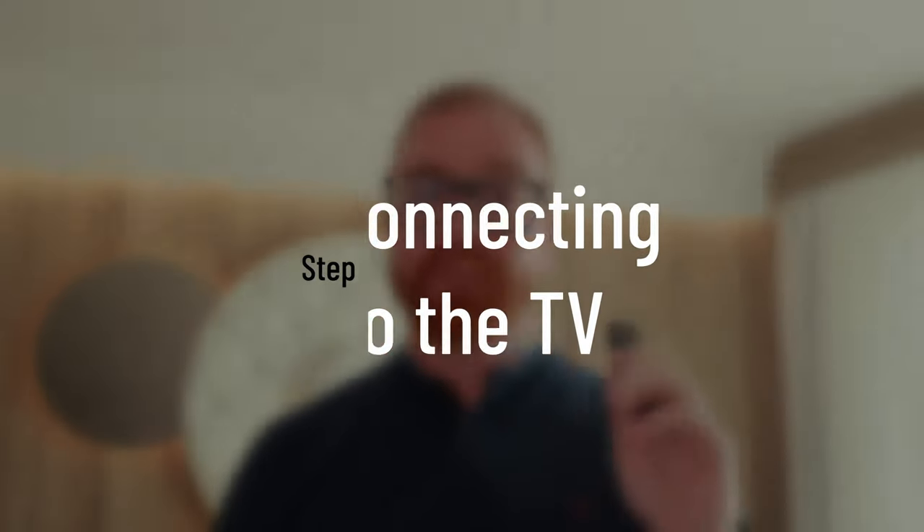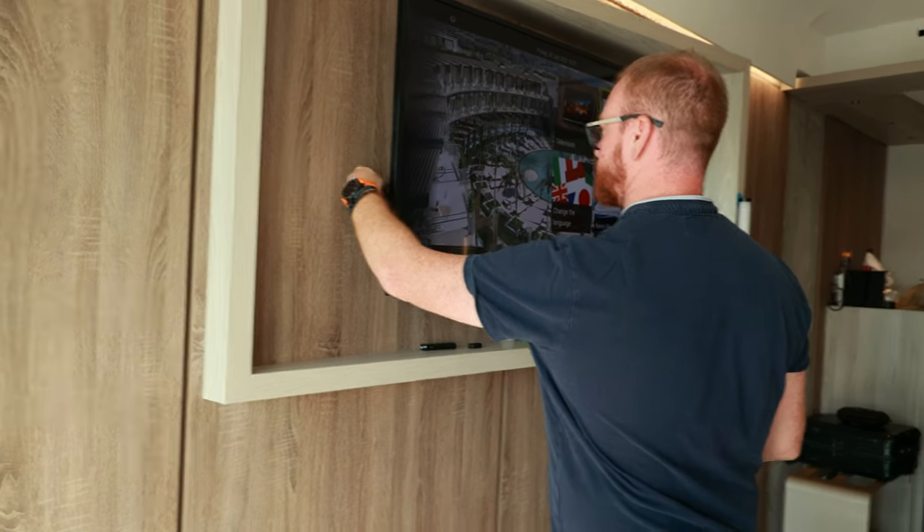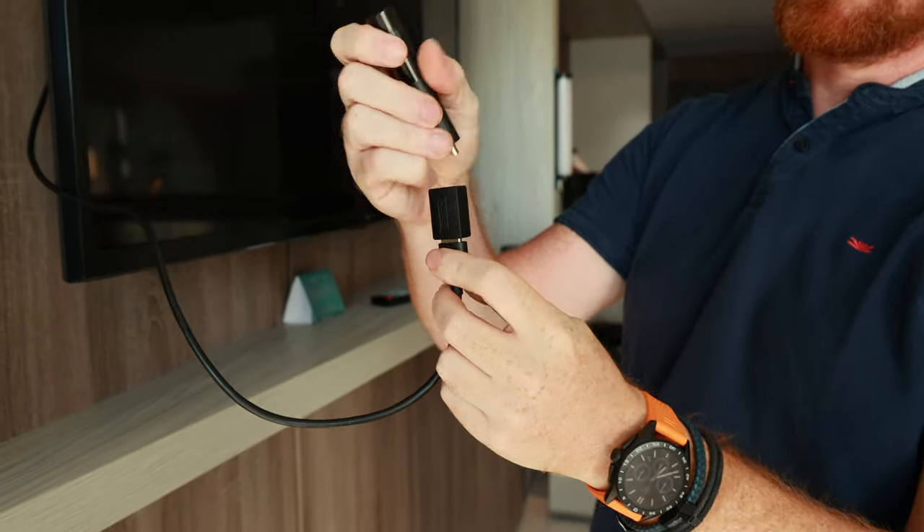Now that we have the hardware, step number two: connect the hardware to the TV. It sounds easy, but it's not as easy as it sounds. If you're really lucky, you have the HDMI and USB ports of the TV just exposed, and then you just plug the streamer in there and connect the USB power — that's it. In many hotels, you have the TV connected to an external set-top box that serves the hotel's portal. If it's a set-top box, you just pull out the HDMI cable, use the female-to-female connector to connect the streamer to the HDMI cable that's already connected to the TV — no need to change the input, no need to disconnect the TV.